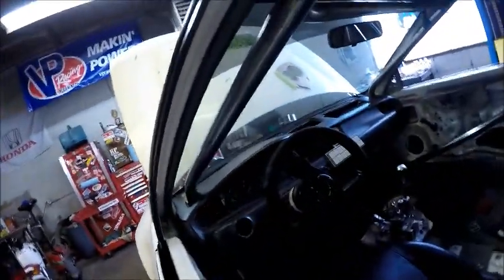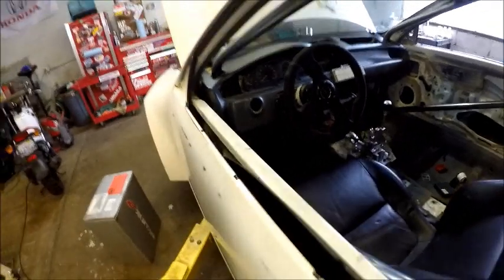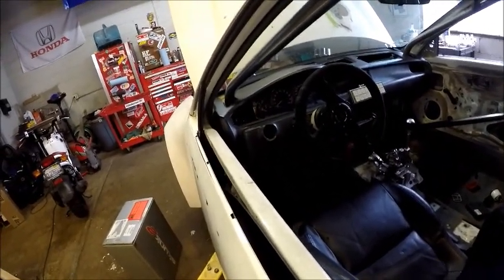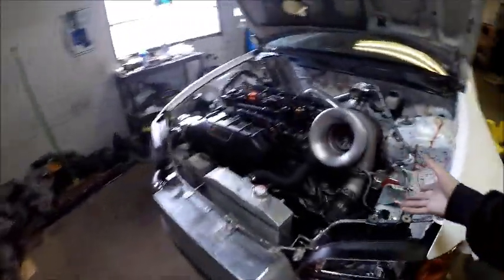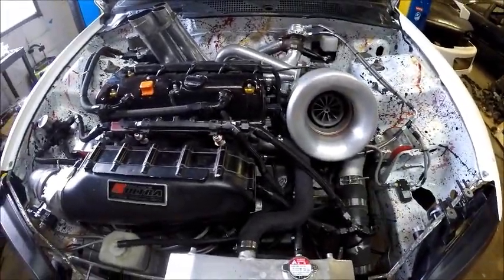And this is the same cage that I got for the car. This is a Rhodes cage, 10 point. So this car, we just got it running actually. This car ran, I think, 880 two years ago at World Cup. So the setup's still the same. We actually went from a Garrett with a 7285 precision, and now it has a GT45 Garrett. So let me see if we could get this running for us.